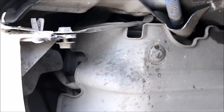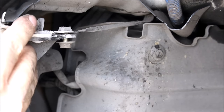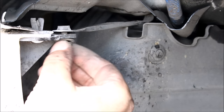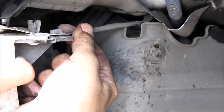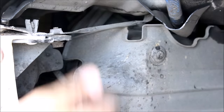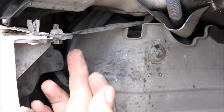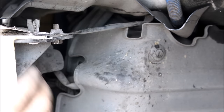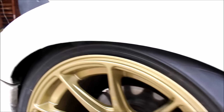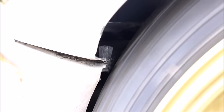This trick is pretty Miata-specific but it demonstrates the kind of ingenuity you need to get good wheel fitment on any kind of car. There's a support right here that's actually supporting the fender and the bumper, but I'm having some tire clearance issues with this part, and I still want to run this support. Here's what you can do: remove the bolt, push the support up to the very front of the tab, put the bolt back in, and put that assembly at the very front of the tab. I had to clip just the very tip off with a razor blade, and then I was able to use the bolt to pinch the support rod onto the front of the tab — it still supports it like stock. Now I can cut this plastic bumper tab. Even with the suspension fully compressed, we've got full turn-in clearance on the fender and the tire completely clears the tab.